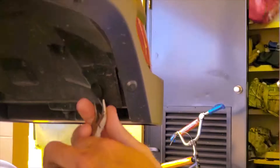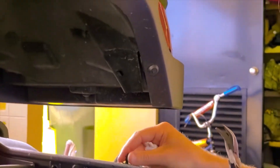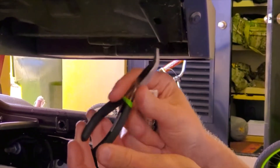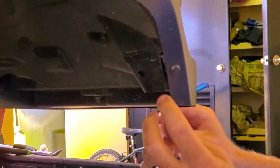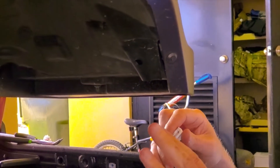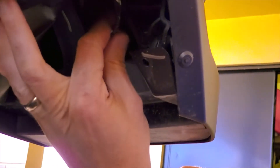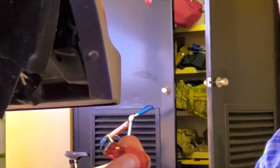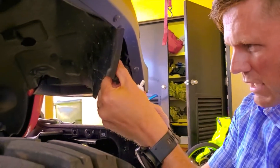It's as simple as getting your tool up under here. Went ahead and got under here, pulled my plastic retainer. I like to use these pliers that have the bend in them — they're needle nose with a bend, and that allows me to get some leverage. I know they make tools for that specifically, but I just find that those work so well. Probably the easiest mod you're going to do on these Jeeps is to pull this fender open, and there's literally the bulb right here. Turn this, slide it out, pull the bulb out. It's just pushed in. And then you will slide the new ones in.